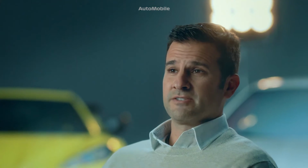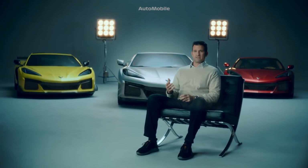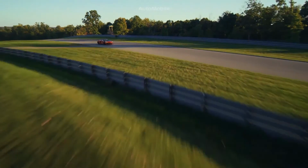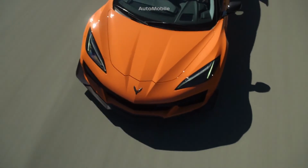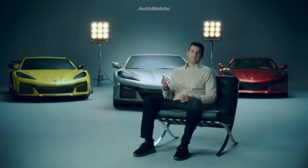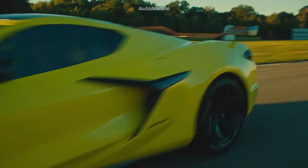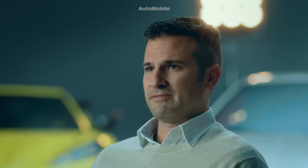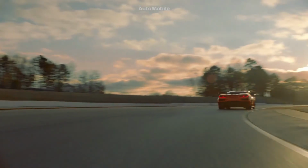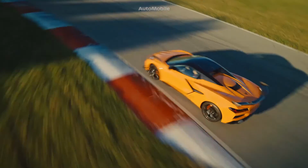It's a little bit of an unconventional setup of what a normal Corvette has, in that the front ride frequency, which is kind of what you feel in the car, is higher than the rear. You have a lot less inertia on the front to provide this immediate input that then is reacted through the car. You can kind of just feel the car leading itself into the turn. You don't have to think about it much. It's a little bit of this innate feeling from the car that really comes through. It's extremely rewarding to drive.